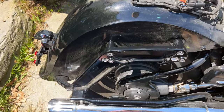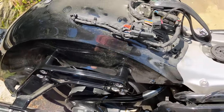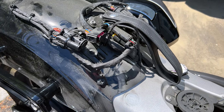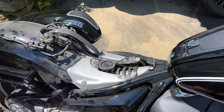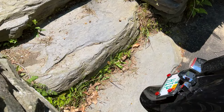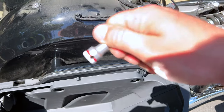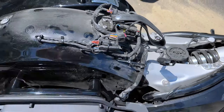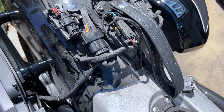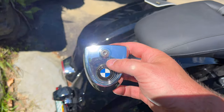Now we're going to reattach the bags. You can see the dirt marks at the bottom — line up where those marks are since the rubber bottom just sits right on top. Make sure you put your zip ties in before you run the cable for clearance reasons, then grab your bag and place it on the carrier and start screwing in the T40s. Torque those to 19 Newton meters, tighten them down, cut the zip ties, then reconnect and slide the connector in — no pick required for reinstallation.